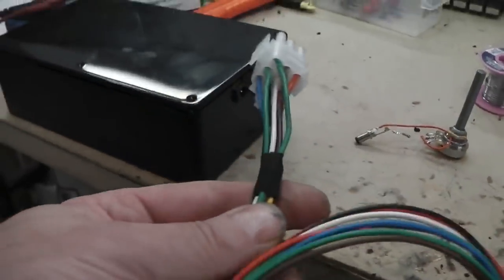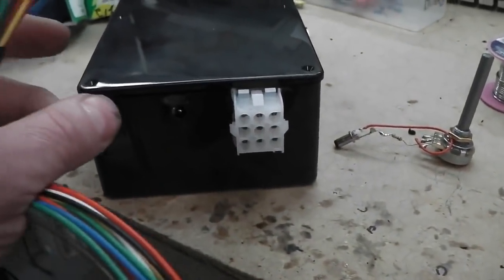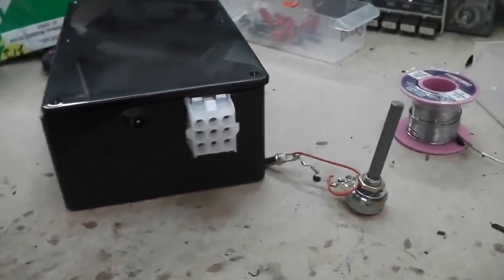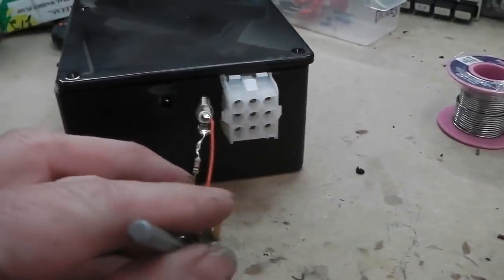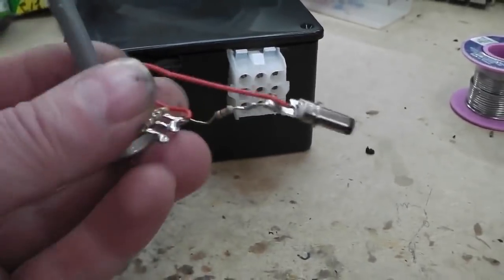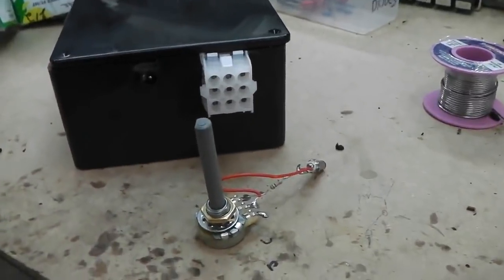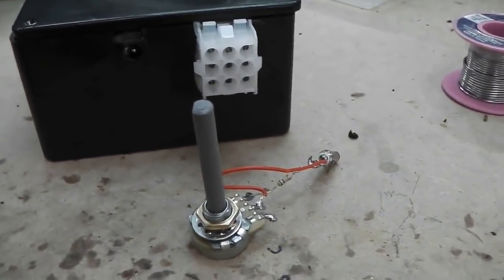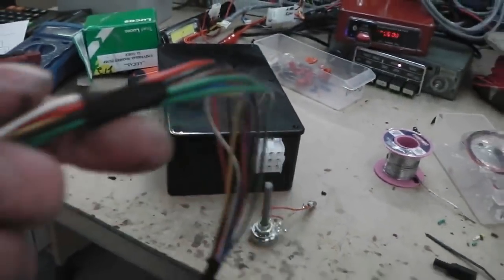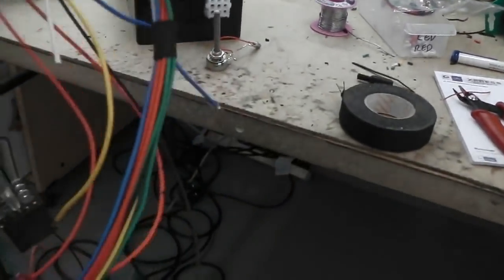That is the multifunction plug. Everything is in one plug. We've managed to get all the outputs in one plug. The control resistor for the intermittent delay just plugs in on a little two-pin plug there. Just got it mocked up like that, but that'll be a longer lead going to the console on a selector switch. But it's time now to wrap this in the Ford loom tape just to keep it looking original.